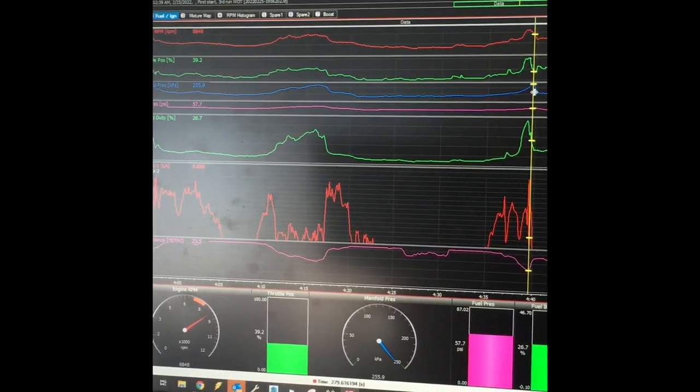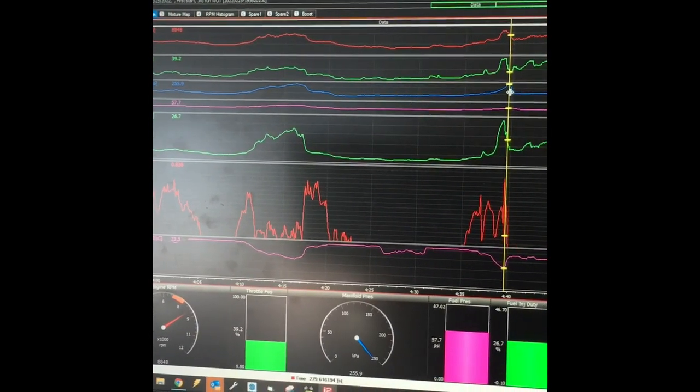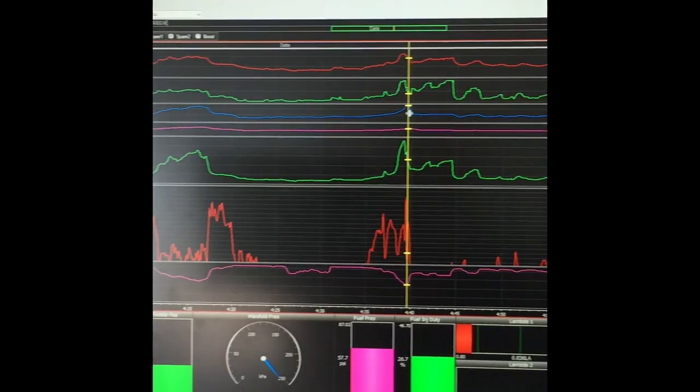The advance worked good - you see the pink line on the bottom, it runs around 41 off the throttle, and then boom, drops instantly down to 25, 23.5. So really safe timing, probably causing some burbling.